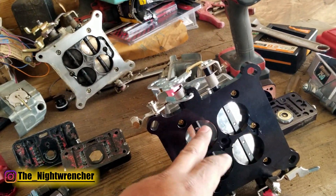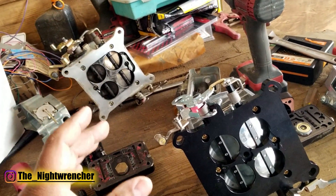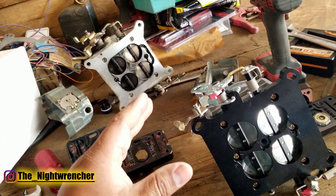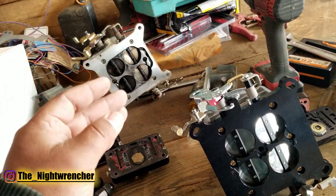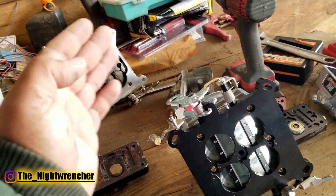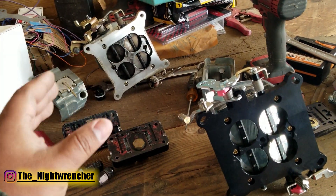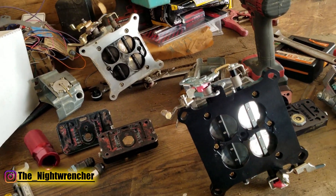Now you also need to modify the secondary IFRs so they can feed the T-slot at part throttle. There's a lot of things to tune for, and the easiest way is hitting it one thing at a time. I had another video showing the pyramid of how I tune carburetors — tuning a blow-through carburetor is almost exactly the same way. That's why if you don't know how to perfectly tune a naturally aspirated carburetor, you won't be able to tune a blow-through carburetor. This was a lot of information and I had to split it into multiple videos, but I hope it helps somebody. I'll have links to everything in the description below.